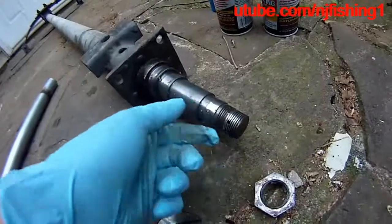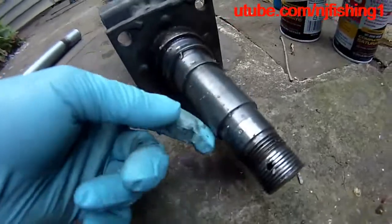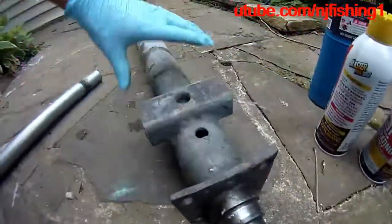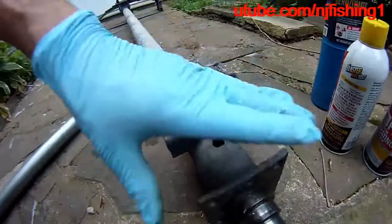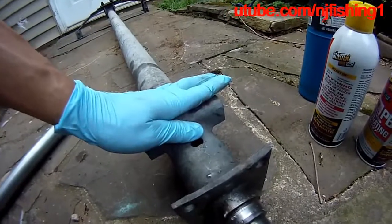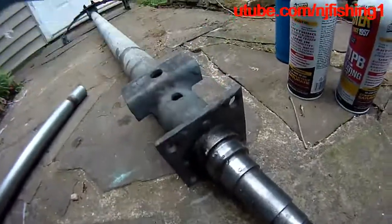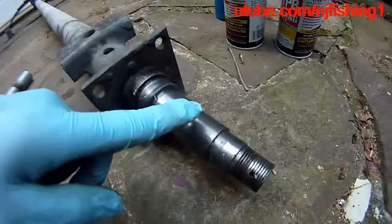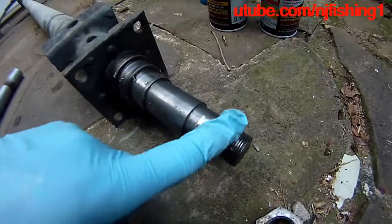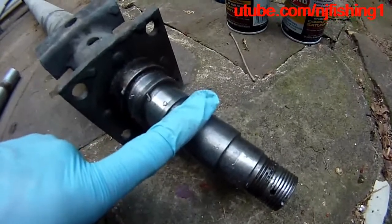So now that the castle nut is out and the wheel hub is out, I'm going to re-pack the grease for the bearing. This is a standard number 84 spindle — this whole piece is called the axle that hangs underneath the trailer to give the tires their suspension ability. This is the axle, which is standard — I believe this is 1 and 1/16 inch, this is the thread which is about one inch, and this is the 1 and 3/8 inch section.